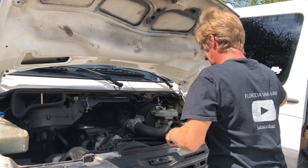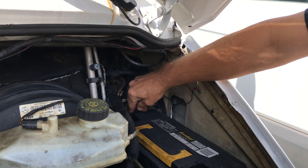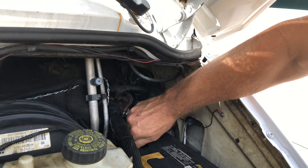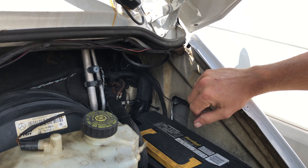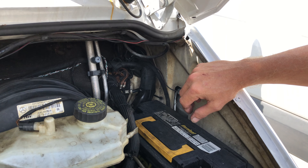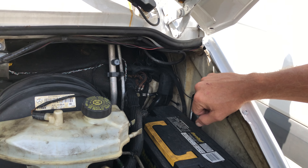That's usually a severely dead battery. For the purpose of our video today we'll pretend this was corroded and we had a bad connection here, so we're going to take that apart, clean it up - wire brush, whatever you've got. An old rag on a battery terminal will rot away, so make sure it's something you can throw away when done. You can even pour Coca-Cola on the terminals to clean them up - they tell me that works really well.